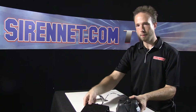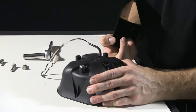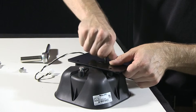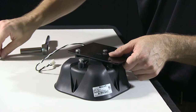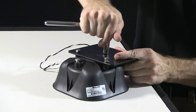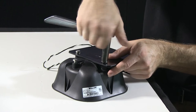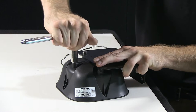Take the SAK bracket again and realign the three mounting holes going through the plastic housing to the bracket itself. You may just need to do a little bit of wiggling to get your holes to line up properly. Take the base mount bolt and tighten it down somewhat by hand, then pull the bracket onto the housing. With the other two bolts as well — hand snugged — go ahead and tighten them all down. Then tighten the top bolt to hold the driver firmly in place.